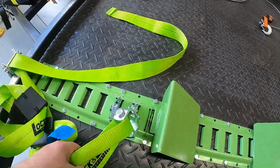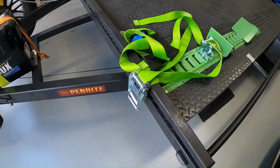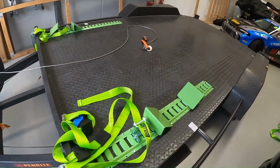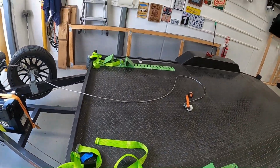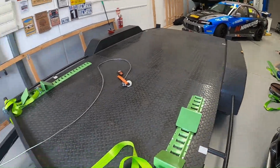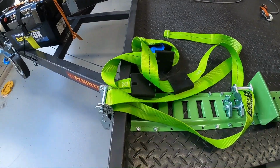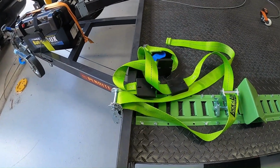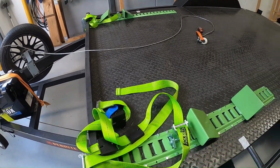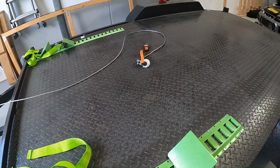Again, you've got your idlers there, and the ratchet. In my case, I've got the ratchet put on the front there and bolted to the trailer. So got the pair there. Obviously I measured the track of the wheels before I popped it on, and I also made sure that the spacing at the front was correct in terms of where I wanted it, in terms of the length on the trailer too. So I made sure they were the same distance on each side.